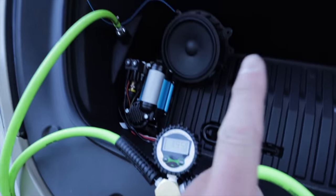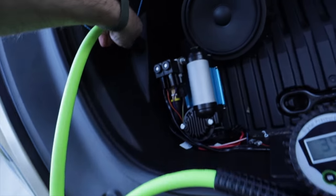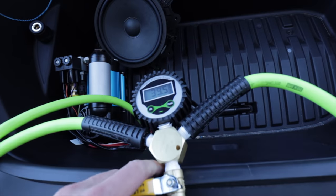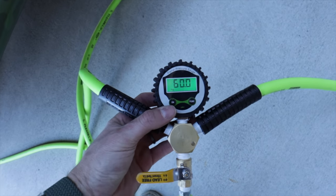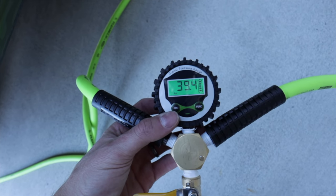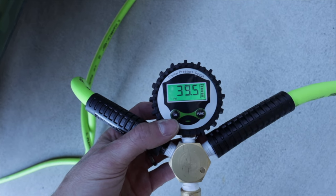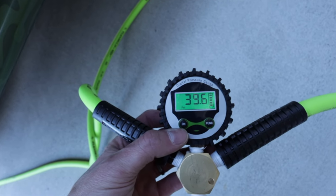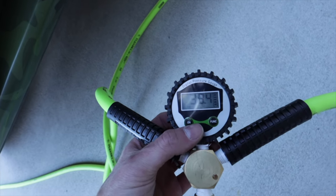The ARB reads 40 inside and this gauge shows 39.5. I capped this off and disconnected here to see if it will hold at 39.5 - checking for air leaks. It's been an hour and let's check if we lost any pressure: 39.4... actually still the same, 39.5, and it just went up to 39.6. How are we gaining pressure? Anyway, we didn't lose anything - all the seals are really good. So obviously this does work - it fully inflates all the tires at the same time.